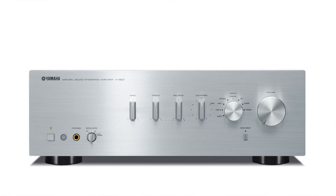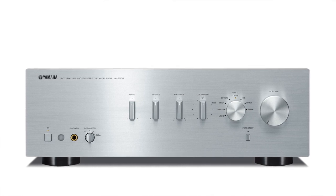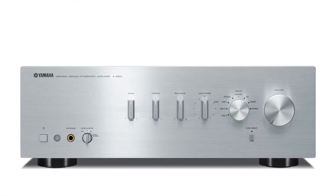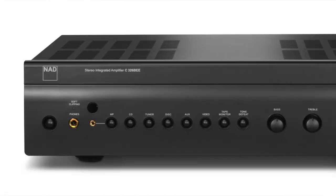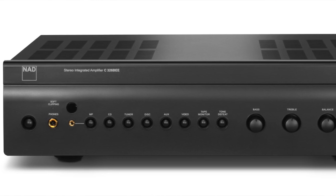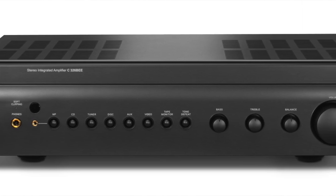And another question, should you go for an amplifier that's rather simple in its design formula, or do you need to head for an amplifier which is rather busier? In general terms, and again, there are plenty of exceptions, the cheaper the amplifier, the busier it tends to be in terms of additional bits and pieces. Hence, low-cost amplifiers tend to provide value in terms of extra facilities such as built-in DACs, Wi-Fi, Bluetooth with those screw-in aerials at the back, lots of digital connections, possibly PC-type interface sockets for push-in pods to add more facilities, AV this and home automation that, 70s style tone controls, and more.